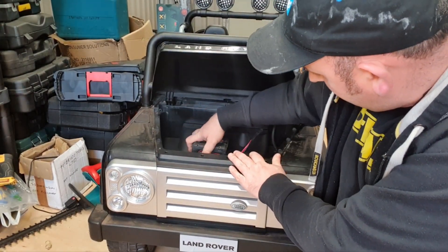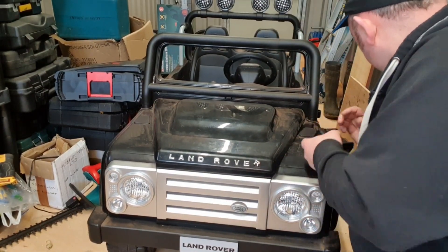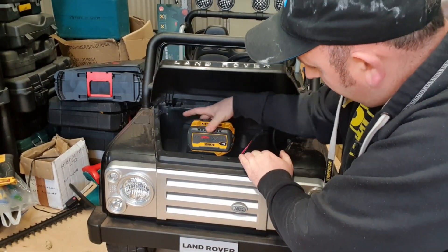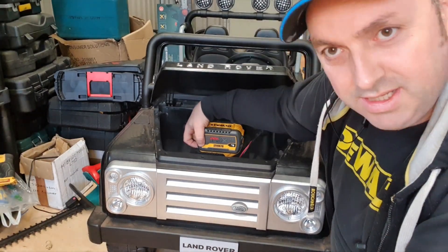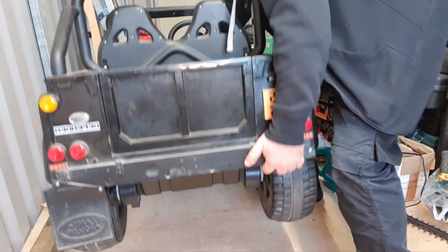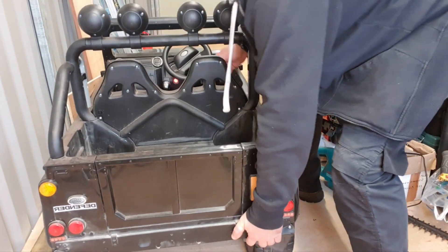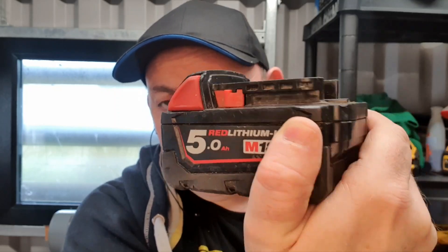She can comfortably take this five amp load. There's a little bit of electrical tape, and I'm flexible to work with the dual Milwaukee battery adapter. It doesn't go quite perfectly flush but there's plenty of capacity for bigger batteries — that's the point. I would say that's pretty good. The point of this exercise was to take an antiquated battery system and replace it with a more updated, easy to charge, quick to charge, higher power delivery system — and I think we've done that today. If you like this video, please give it a thumbs up and subscribe to my channel for more of this type of content.